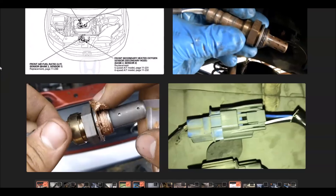So what do you do if you have a Honda P0157 code? First, locate that secondary oxygen sensor on bank two, which will usually be in the front of the engine down below. You might have to look it up since there can be variations by year. Once you locate it, check the wiring for open shorts or bad connections, and keep in mind this circuit is on a fuse and sometimes a relay. If everything checks out, then test or replace that oxygen sensor, because very likely that's the issue.